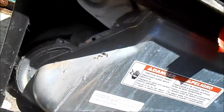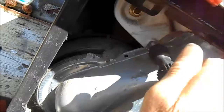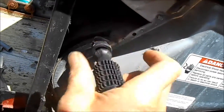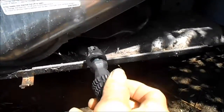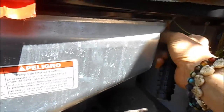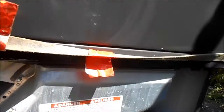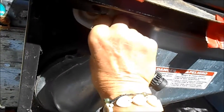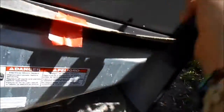This is like a little quarter-inch nut and you can take these parts off to get right to the blower and inspect the thermostat. The thermal cutout is on the blower housing - rather than taking the whole thing apart, you can just pull this blower housing out and run your meter on the blower thermal cutout. You also need to remove your lint filter and pull that out.